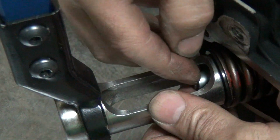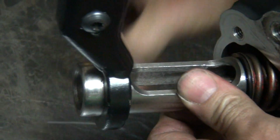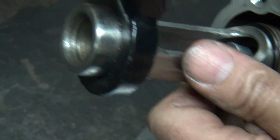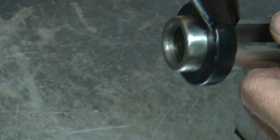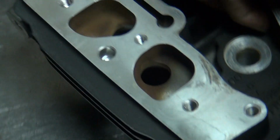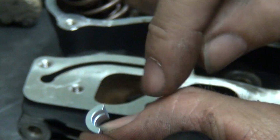I just turned the spring at 180. Maybe that'll make a difference. I don't know, might not. Sometimes I'll keep it, it won't go in. Is it centered? They're never perfectly centered, but in this case, it won't even begin to go. It overcomes my thumb, so either I hold the tool over or I hold the center. It's hard to do both. I was able to do both that time. So when you run these really thin wall retainers, keepers, there's almost nothing to grab a hold of there. You only got like 15 thou to grab. It doesn't take much to have a problem.